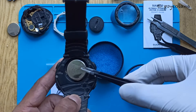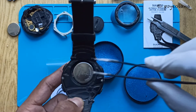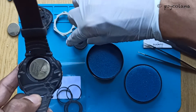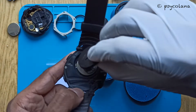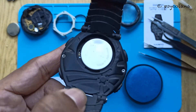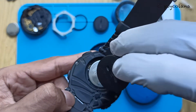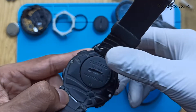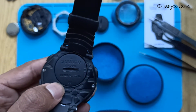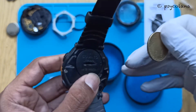Place the new cell into the battery compartment negative side down, so the positive side will be on top. Ensure that the o-ring is in its place to keep the watch waterproof. Place the battery compartment cover back onto the backside of the watch, then using the coin turn the cover clockwise to the close position marked on the back of the case.